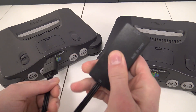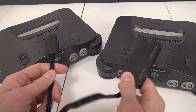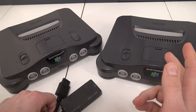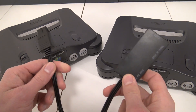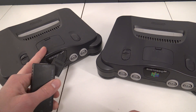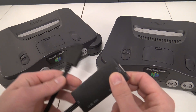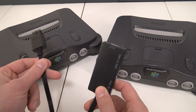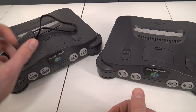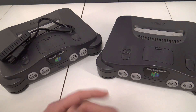I must say, first of all, this thing becomes a little bit hot if you use it for a couple of hours. The idea that you just plug and play it — HDMI into your Nintendo 64 — is pretty cool. But the first disappointment is that with the PAL version I couldn't get any normal signal. It did say PAL signal input and everything should be working, but I didn't get any image. The Japanese version — or better said, the NTSC — works like a charm, just fine. The 1080p still has this weird scan line or weird little bar at the side, which is also not good. So if you're going to use it, I'd use it for the Japanese or NTSC N64 at 720p — that works just fine. Whether it's worth the money is up to you to decide. Thanks for watching, don't forget to subscribe and hit the bell, and if you have any questions leave a comment. If you become one of the Wicked Family, I'll see you in my next video.